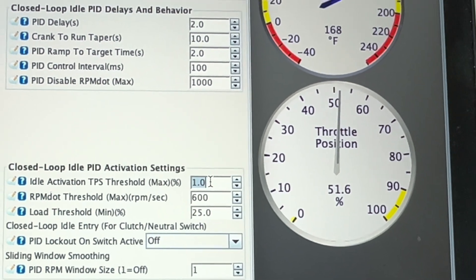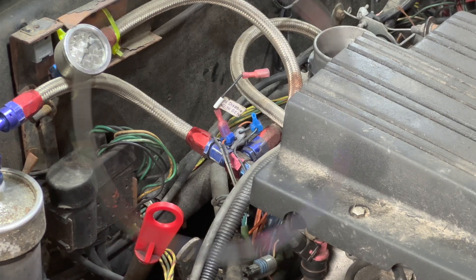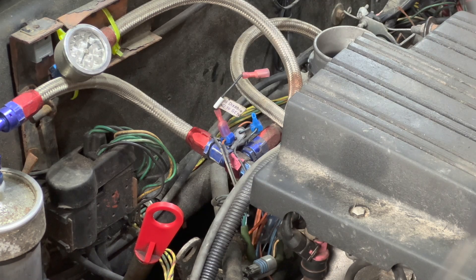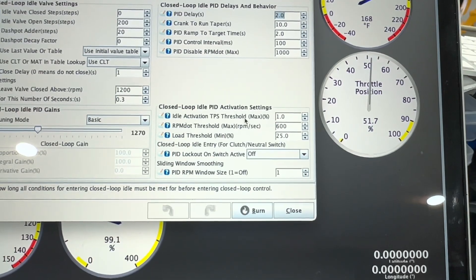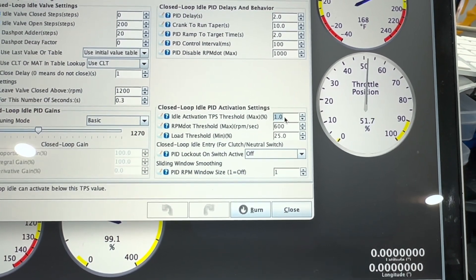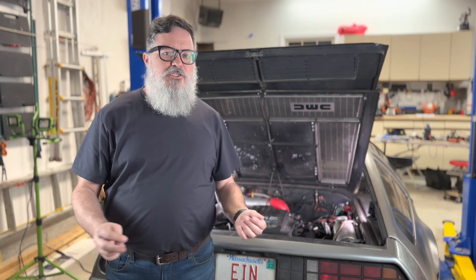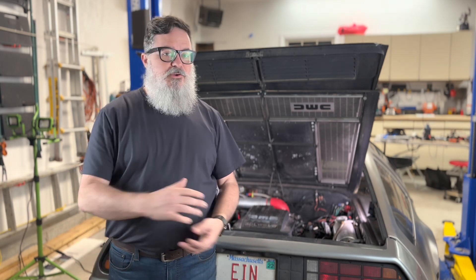That's definitely not right. It turns out the wire I tied to ground had come loose. In electronic terms, this meant the sense wire was floating — it had no specific voltage on it and was just acting like an antenna, picking up random RF noise and passing that onto Megasquirt instead of saying the throttle was closed. The ECU was told to only idle when the throttle was less than one percent, but noise on this loose wire would sometimes bring it above that. In those cases, the ECU would never go into idle mode, so it wouldn't correct for low RPMs, and the car would stall.